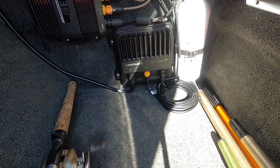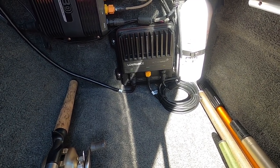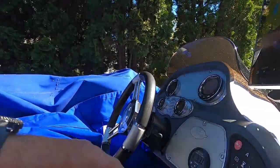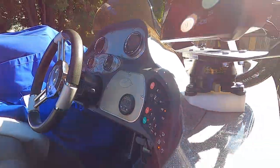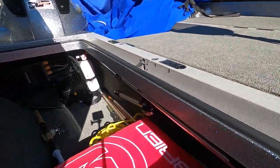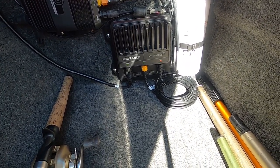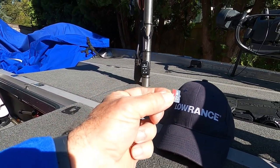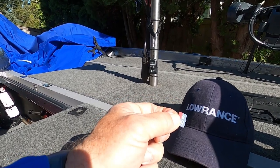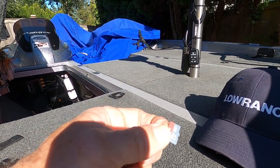The yellow wire worked with the past update to turn the module on. The problem is the yellow wire wouldn't turn the module back off. When I go back to my dashboard and turn my accessory switch back off, the module should shut off. But the software didn't get completed properly initially. As you can see, even though I have the yellow wire accessory switch turned off, the unit is still powered on. The software update I downloaded onto this card is what's going to fix that problem. Once I have this uploaded into the ActiveTarget, that yellow wire will work like it should — turning the ActiveTarget unit on and off again.